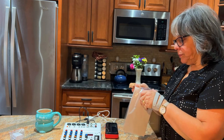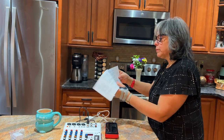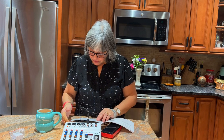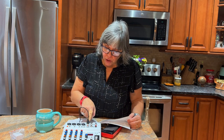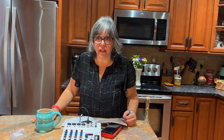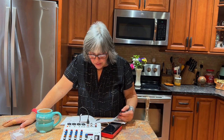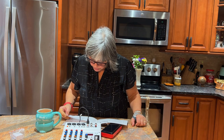I'm going to read the instructions. There are some in English — I got a little nervous there. It shows type-C power, mic line, gain knob. You can also play from a flash drive — I'll never do that, but that's interesting. And the pad button — I'm pretty sure that's the difference between an instrument input versus line. When I see 'line' on a mixer, I know that means like a keyboard or drum machine.